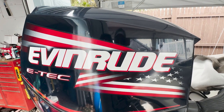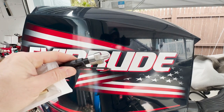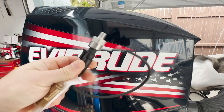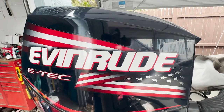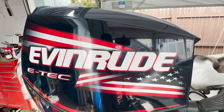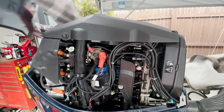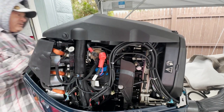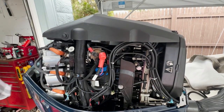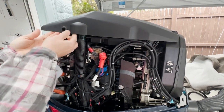The first thing you're going to want to do is take the cover off. This is a picture of the water pressure sensor — I'll have a link to it in the description down below. This is a 30 PSI water pressure sensor. Next you're going to want to get the plastic coverings off of your motor — those just simply pop off. There are two rubber grommets on the back side and two rubber grommets on the front and back sides of the top cover.